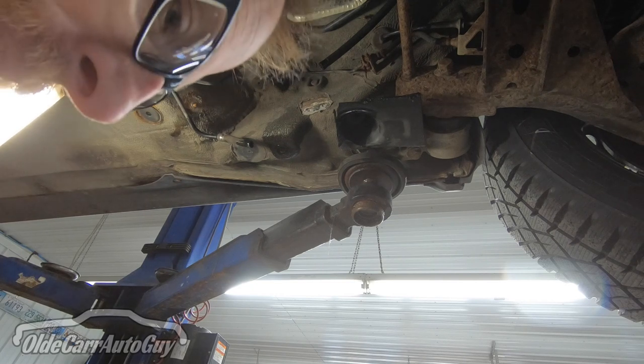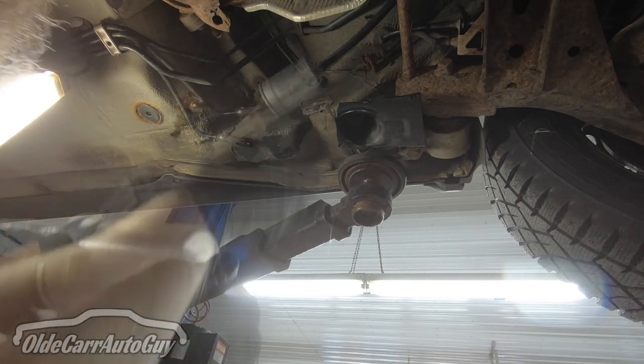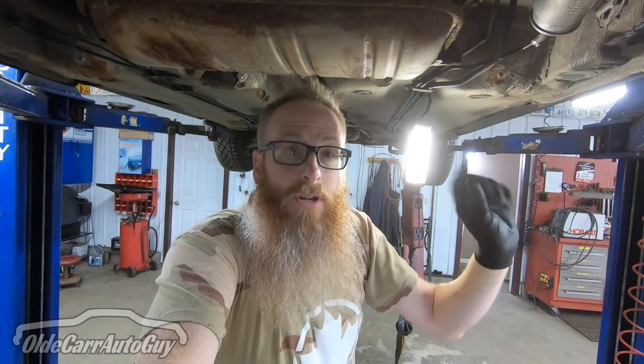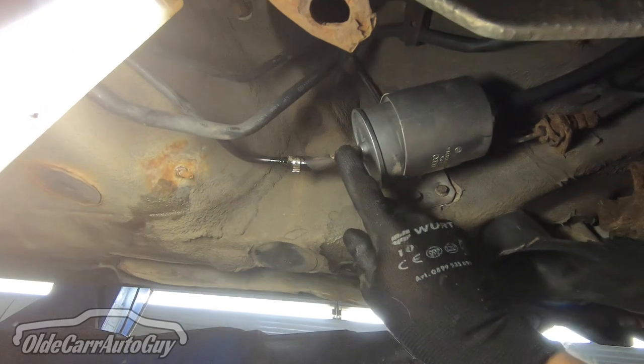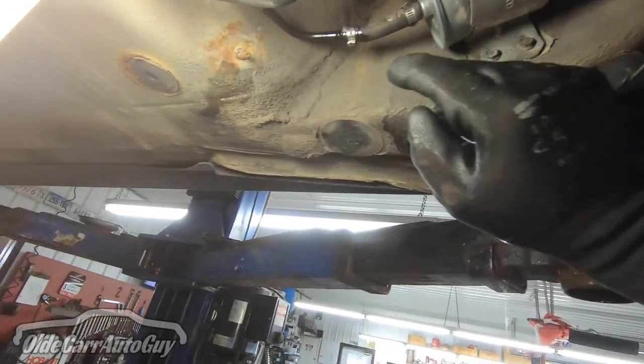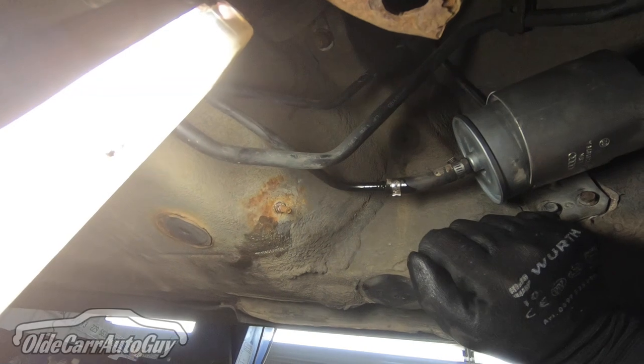The quick and easy way to get it to stop dripping is to plug in the new filter right away so it's not dripping on us. We need to get some small clamps on there and we're done. Now that the fuel filter is in place, we're going to cycle the key a few times to fill it up, then try to start the vehicle and make sure everything starts with no leaks. There's no seepage where we put the new clamps on, but the previous clamp is now weeping, so we've got to replace that one as well.